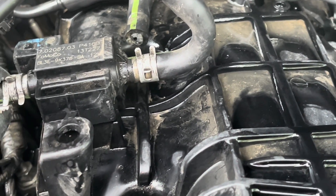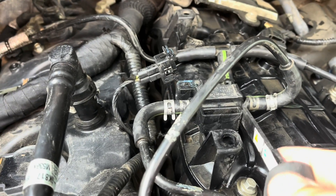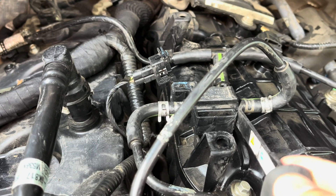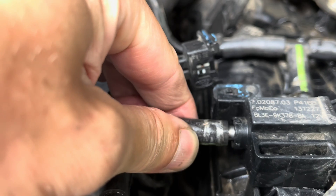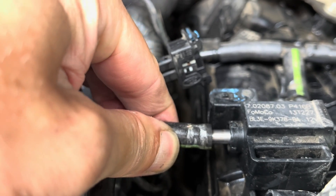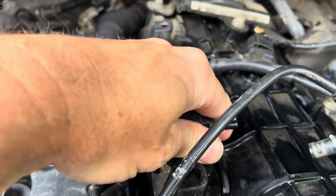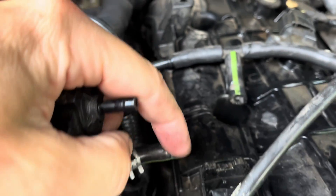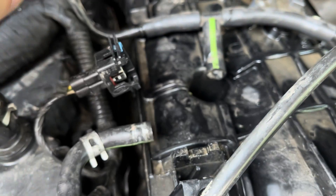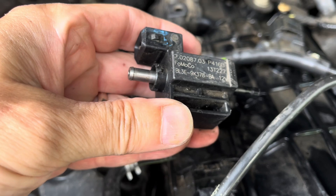There's a little slot — I don't have the right tool for this, but eventually I get it. Now you just slide these hoses off. This is a plastic end, just like the plastic end that broke, and of course this is a metal end — you don't have to be quite as careful with that one. Yours may be on there tight, but see that little open slot? It just sits right on this little tab that's built into your manifold. Be careful, do not break that.